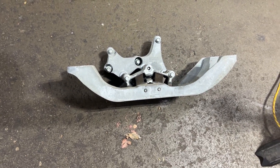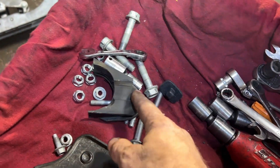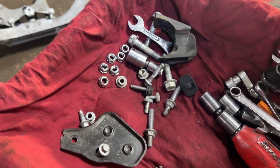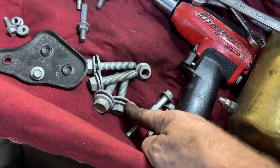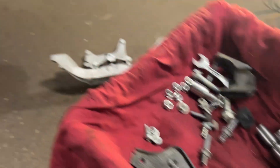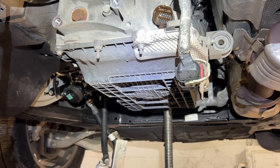It wouldn't slide back. Took the driveshaft bolts out. The starter loose. There were 6 torque converter bolts. Remove that from the rear mount. These are bell bolts. Now it's pretty much time to pull the rest of the bell bolts and take the tranny out.